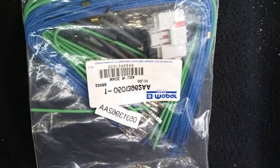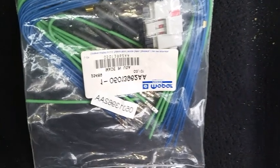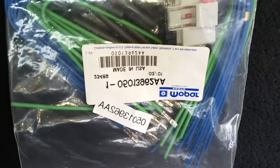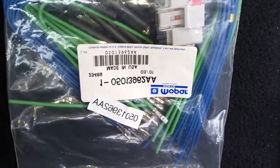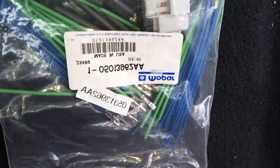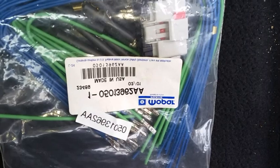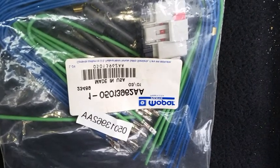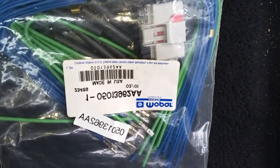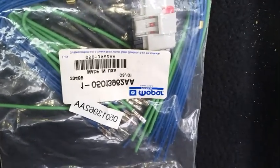Look for either part number, and most people will not be concerned with what color the connector is. They'll just find the good deal on 501-3961-AA or 3962-AA. There may be a couple other part numbers, but I think that's only two. There could be some other older, obsolete 14-way connectors that are functionally exactly the same except for maybe some color or minor difference.